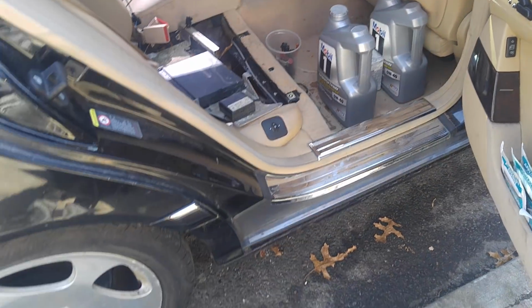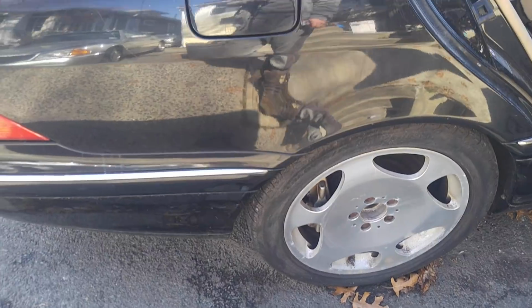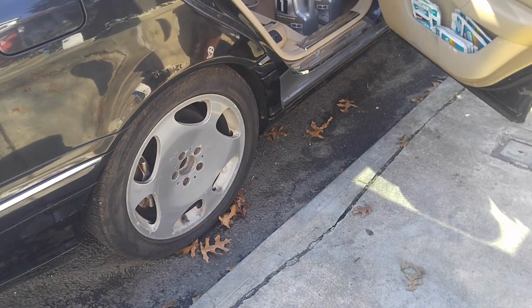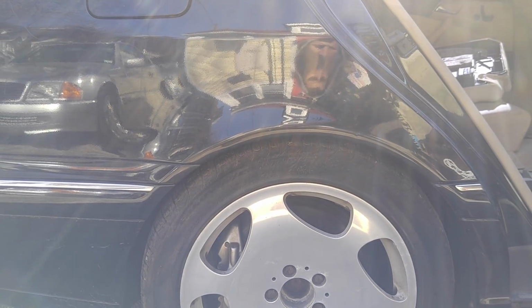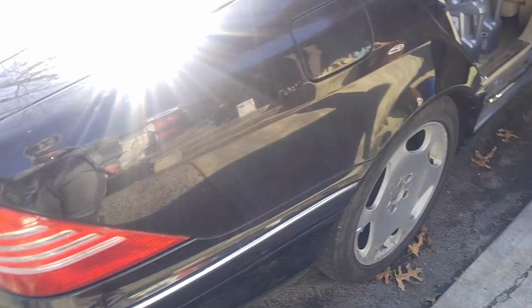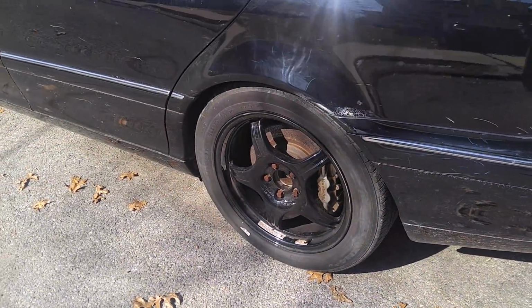Okay, suspension. Obviously, valves are leaking, so the car drops after it sits for a little bit. It's warmer now, so the car didn't drop a lot. It's still lower. As you can see, the wheel is down in. It's like it deflated, the suspension went down. Front ones hold on a little better, but then I get ABC codes anyway, so that is not good. So valves to be rebuilt.